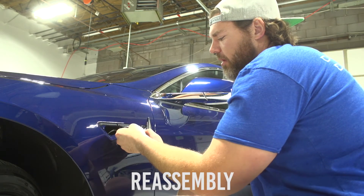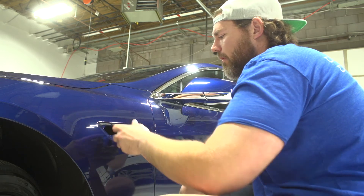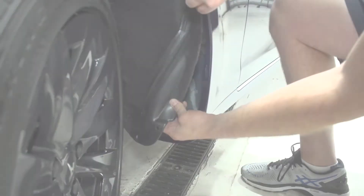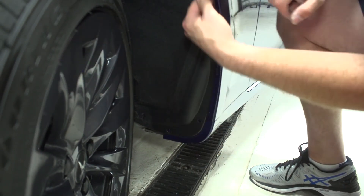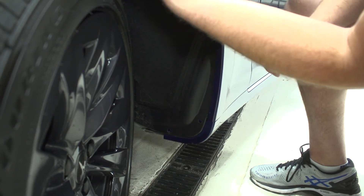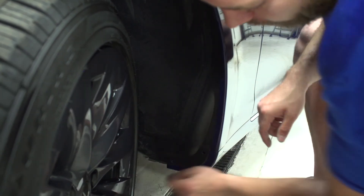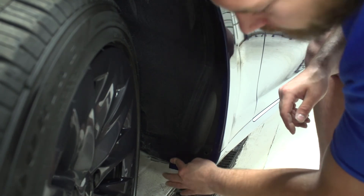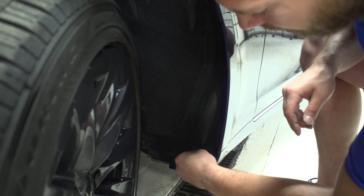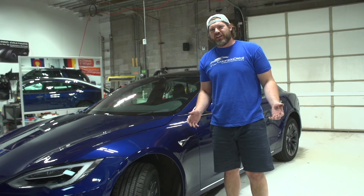To reassemble it's fairly simple — plug it in and push it in. Make sure that the wheel well shielding is pushed behind the fender, because sometimes it gets stuck up there. Pull it and realign the holes, then simply push the two clips back in.